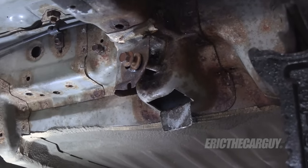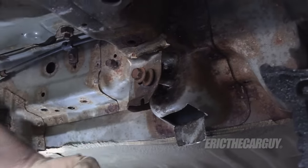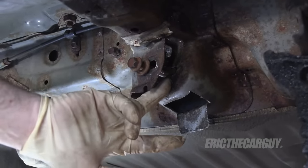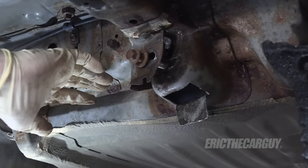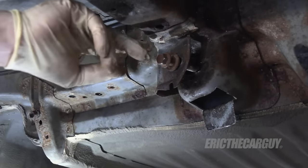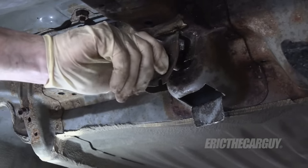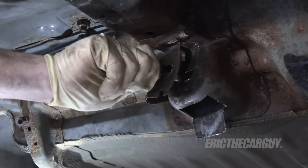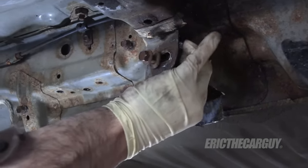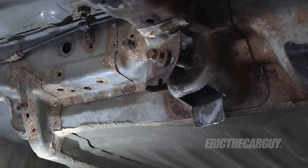This is the most difficult part of this, and I've encountered this more than once. This is the toe adjustment for that rear control arm. There's a little arm that comes off of here that attaches to it that allows this to move back and forth. What happened was the nut that's basically captured back here in the side of this assembly came loose. The only way to get to it is to cut this open. Now I've got a welder, I'm going to come back in and weld this shut. I want this to be able to slide back and forth so that you can do the adjustment. It was all bent out of shape — I had to beat it up to get the old bolt and bushing out of there, but now I believe I've got things back to where they're going to work. So this is the bolt on the other side — it's the same bolt that goes in this side. It seems like that's all in there and ready for adjustment, aside from closing this up and welding it and grinding it down and making it look like it never happened. You and I will know, but no one else will.